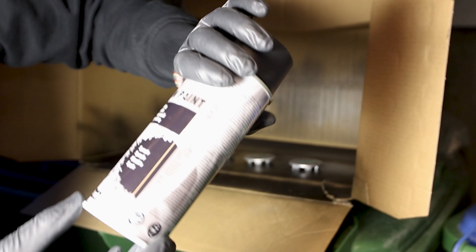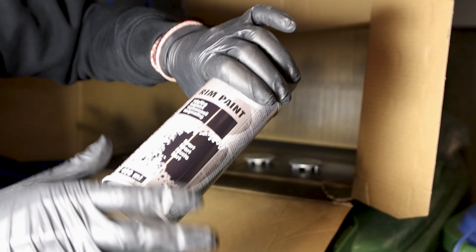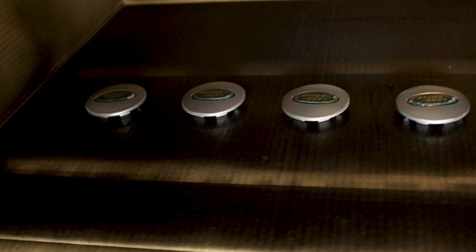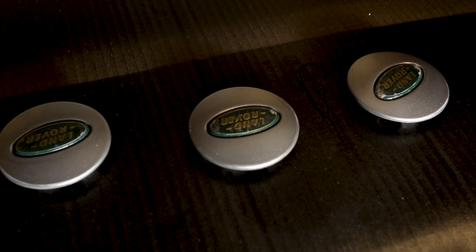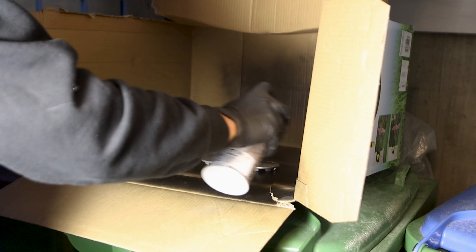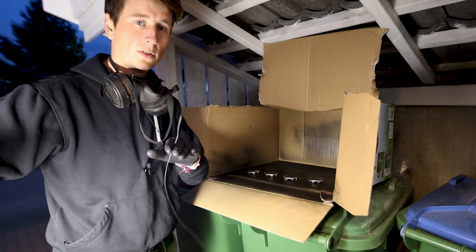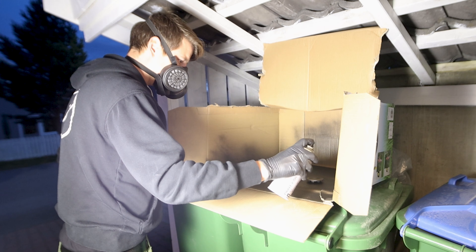Let's get the color on. I've chosen to go with the rim paint, same as I used on the rims. Hopefully it's not going to react to the primer in a way that causes bubbling. It looks like I messed up the primer — it's scattering up on some edges, so I probably used way too much. I need to fix that. I'm putting on two light layers and then going over with a wet coat to smooth everything out — three layers total.